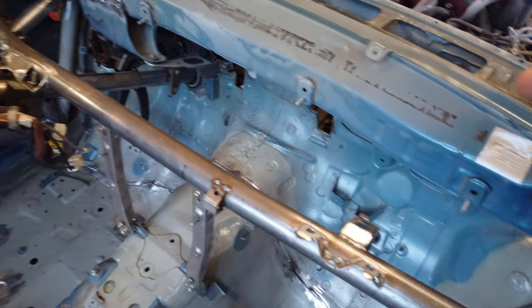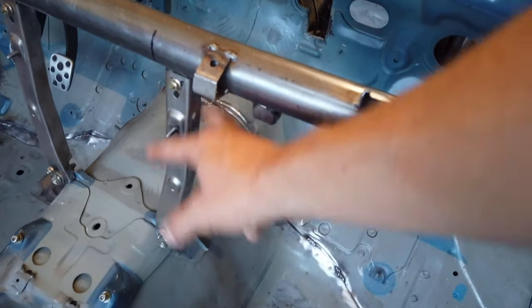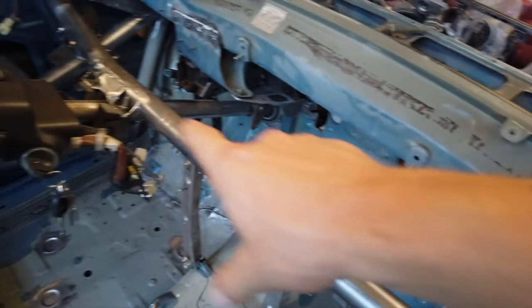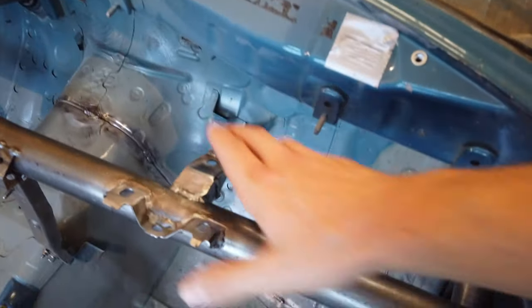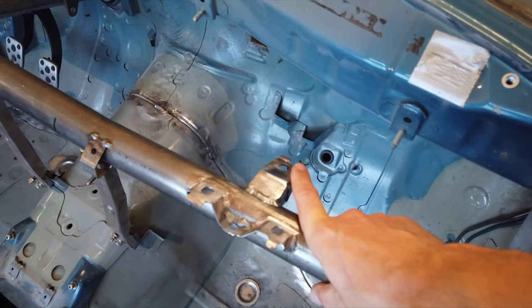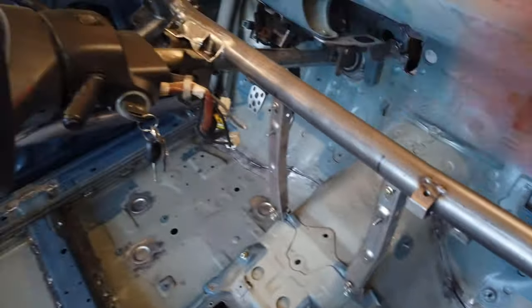I've got all my brackets welded in the exact same location as they were beforehand, and I even modified some of them. Like this one — I added a stud so I can actually just remove that middle part without removing the beam. I also adjusted the position of the steering wheel a little so it fits better with the GD column, and I tried to keep the airbag as close as possible to the original fitment. I had to build a little standoff on the bottom piece. Now the next thing to do is add these FIA approved joints, or couplers, for the roll cage. They can be welded in and allow you to remove pieces of your roll cage without modifying the structural integrity. I'm going to put one on either end of the dash beam so I can actually remove it.